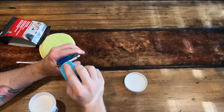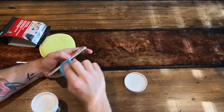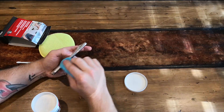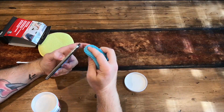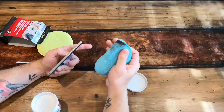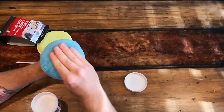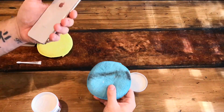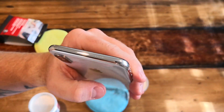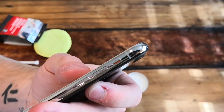I'm going to use the rag this time. My main focus is the top and bottom, because that's where my device is most scratched. When you're done, you could actually just rinse the phone off in the sink if you wanted to — the iPhone 10 is IP67 water resistant, so a quick rinse wouldn't do any harm and would get all of the compound out of the nooks and crannies. Already the top looks better — nice and shiny.